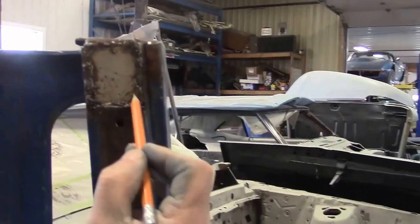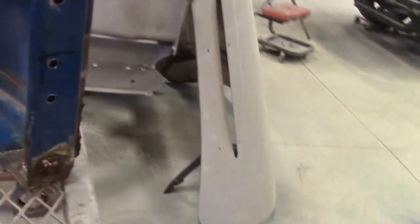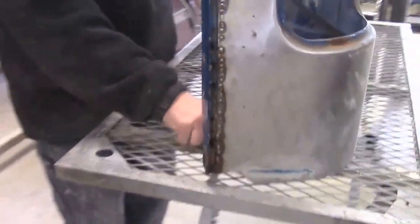This rectangular section was quite punky, so we cut that piece out and welded in a new piece — that's very common down here where there's stress. It's a trickier panel. We had to basically make a box, then a bottom plate with a support piece to make it look exactly like factory. We cut out all of the rusted spots, made new pieces, placed and welded them in, and we'll be grinding all that smooth — so now we have the structural strength, because before it was damaged and corroded.